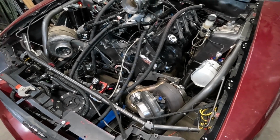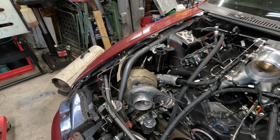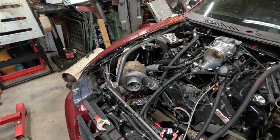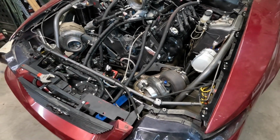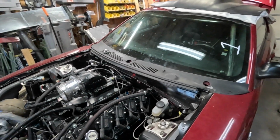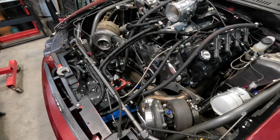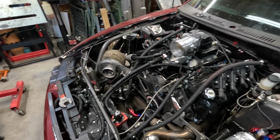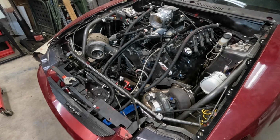And you know, leaving the line, if I left the line at 7-8 pounds, it would take 1.2 seconds to get up to, you know, 18-20 pounds, and that's just a little too long. So we got a little upgrade that I'll show you guys once we get into this video a little more. But at this point, I need to start tearing off these turbos and that throttle body and a few other little things that we'll show you once we get everything squared away. So let's go ahead and start tearing this apart.